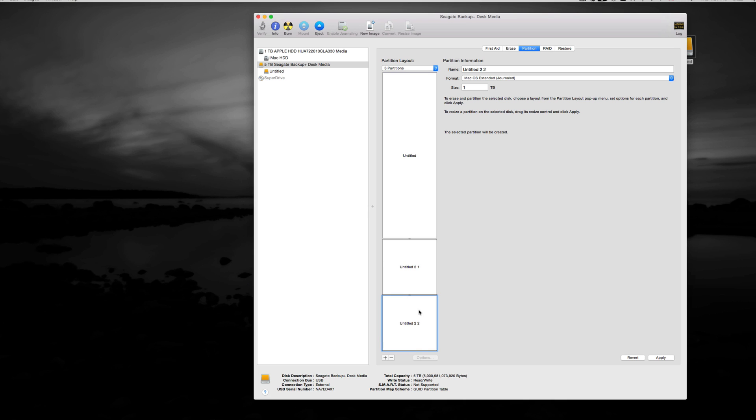Here's the cool part about your external hard drive. If you only have one external hard drive — which I don't recommend; you should always have two — you may need to share information with a Windows machine. If so, you can format one of these partitions as exFAT so it works with PC. You can name it 'PC' or 'Windows Compatible' so you know that's the only partition that will work with PC.